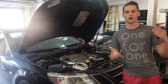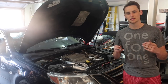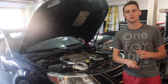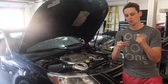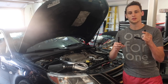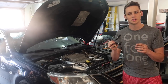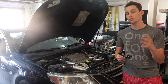If you're someone who lives in a hotter climate, wants to do more performance mods, or especially if you like to track your Saab — because there are people who track their Saabs — you definitely need to do a mod like this. When your engine's running super hard, that coolant's getting really hot and putting a lot of stress on the cooling system; these hoses are going to be the first thing to go. Just from holding the two here, the DO88 hose is so much stiffer — I'm squeezing it as hard as I can and it barely indents, whereas the OEM hose I just give it a little pressure and I'm touching both sides together. The DO88 hose is much thicker, much better material, much higher quality. Not to say the OEM isn't high quality, but this is just the best of the best if you're trying to upgrade the cooling system.